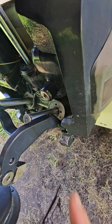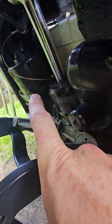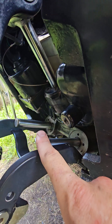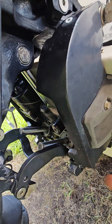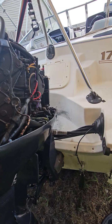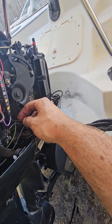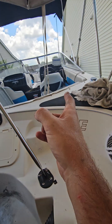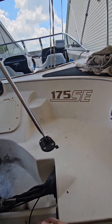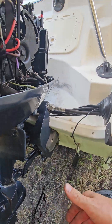So of course I thought it was the motor, which sits right there. Ordered a new one, but it wouldn't arrive until Sunday. So I figured might as well go ahead and troubleshoot some of my electrical. It didn't make sense because even though I replaced those two wires and swapped them around, the switch would work now but it wouldn't trim up. And my handle did absolutely nothing at all — there was just no up. It would go down but the motor wouldn't actually go down either.